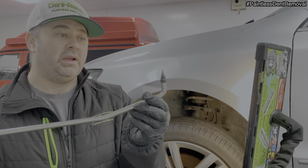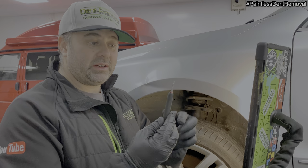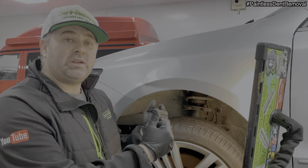This is finally leveled up now. It's not 100%, but it's pretty much there. That took me about an hour to do. In the end, I jumped onto a very, very sharp screw tip. So that's like a needle point. And also I was tapping down the painted side with a polished knockdown. So these are for fine detail, for fine tuning and picking real tiny bits up. So using the sharp tip, I've also shrunk it in this area. So I'm happy with that now.